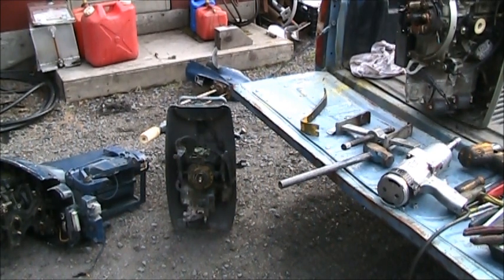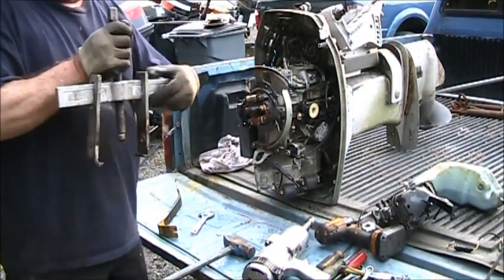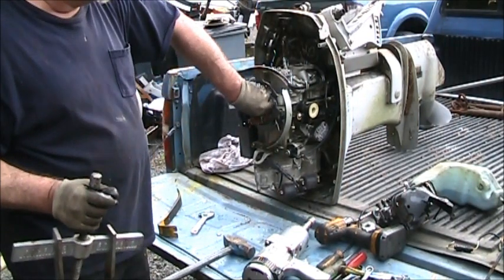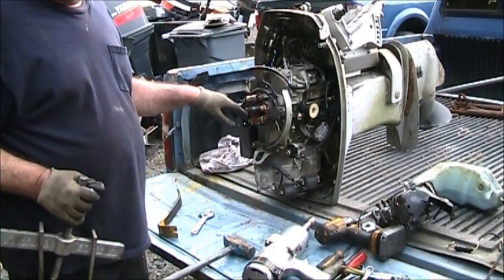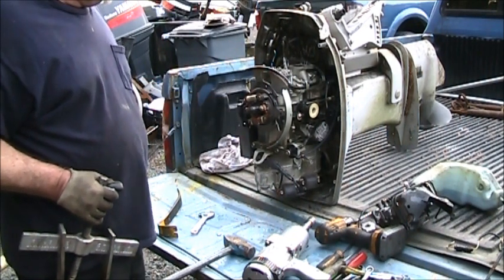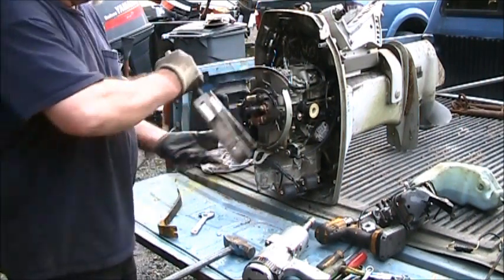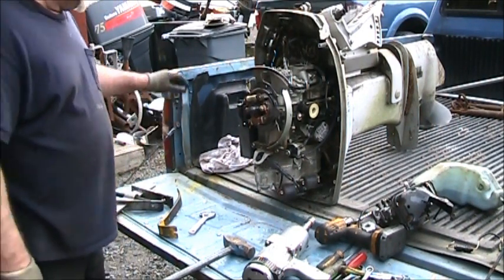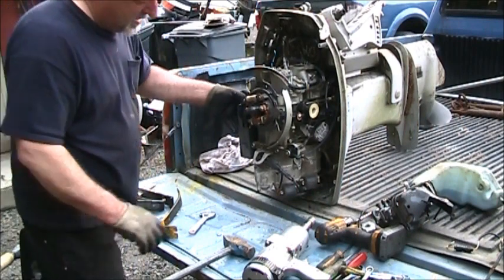But now you'd say, why in the world did I use an old bracket puller, such as that? Take that key away if I can get it out of there too. Reason why I did that is because my puller is a triangle puller. Well, I have my OMC puller set, but since this is being scrapped, I just smacked that aluminum bracket there where I was able to get this puller on, and it just was quicker and easier. That's why I did that, because there ain't much else I'll keep on this. The coils are shot.